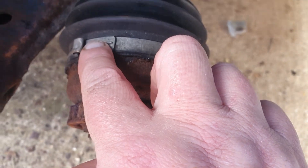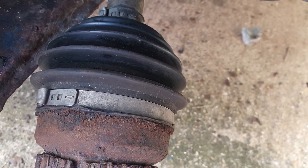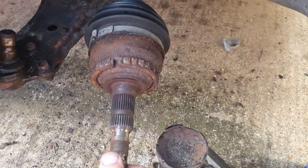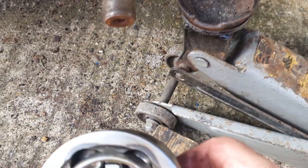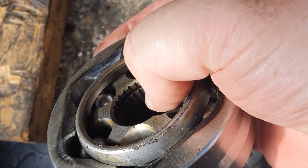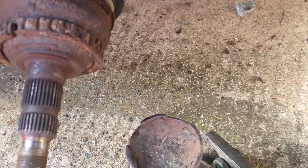The next job is to get these little clamps off here, then slide the boot back — and there's going to be an awful lot of dirty black grease in there. In amongst that is a little circlip that I've got to try and open to pull this CV joint off the drive shaft. That's the drive shaft, that's the CV joint. In here behind here you've got a similar spline arrangement — you can see the splines on the new CV joint on the end of that drive shaft. There's a little circlip in that groove that I've got to release to pull the old joint off.